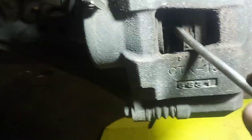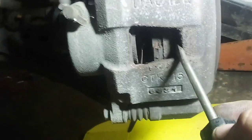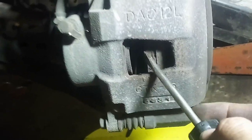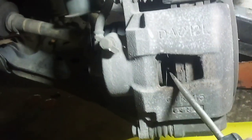Right there's the piston. You want that all the way back so you've got room for your new brake pads to go in there. That'll make it easier when you put the new pads in. I haven't taken the bolts out yet, but now since I've pushed that back, I'm going to go ahead and take those bolts out and I'll show that.